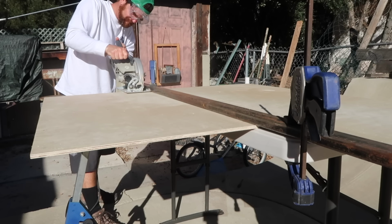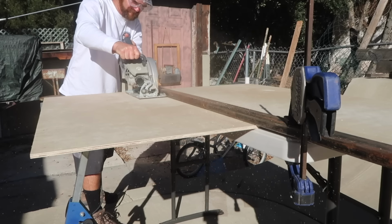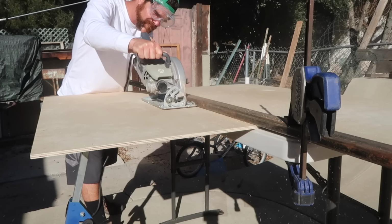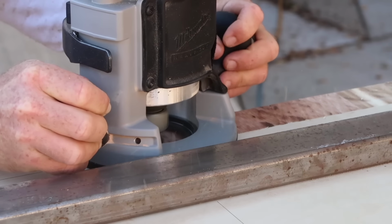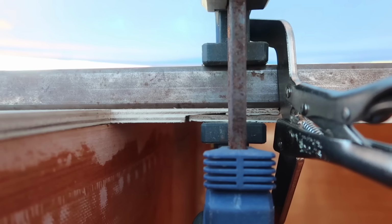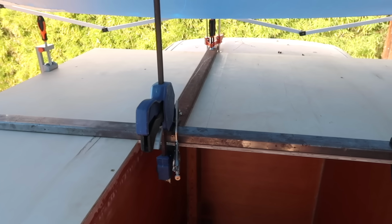I'm building it out of 3/8 inch plywood. Its overall length and width are 128 inches by 75 inches, so I had to cut it out in 3 different sections and join them together. To make the joints, I routed 3/16 of an inch off of each of the joining edges to make a 2-inch wide lap joint, which I glued and clamped together, starting with the section that will be our countertops.